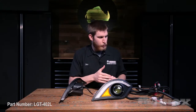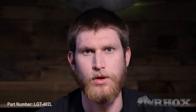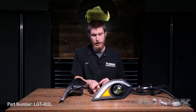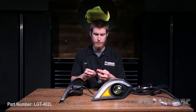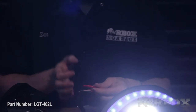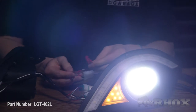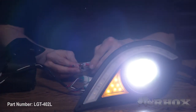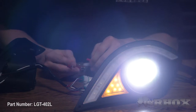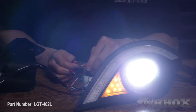Now I'm going to use my push-pull switch just to verify that everything works — and it does. As you notice, when I lit up the lights, the accent light came on blue. That's because my jumper here is connected to the blue wire. Now I'm going to turn the lights back on and go through the different colors. The halo is lit up blue. If I disconnect this, the halo will turn off. If I connect that jumper to a different color — say the red — it'll light up red. The green will light up green, and the white will obviously light up white.